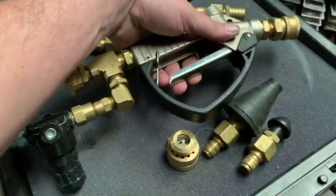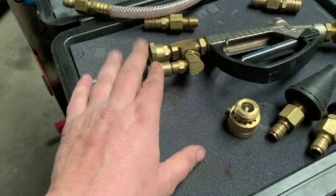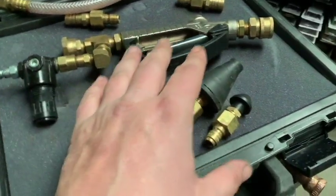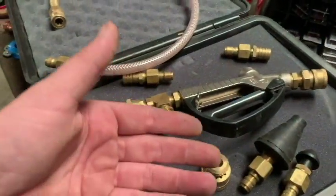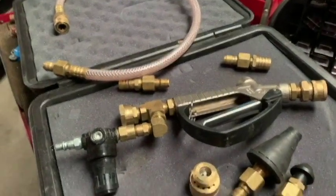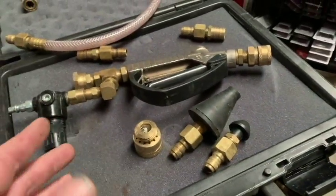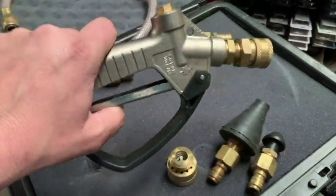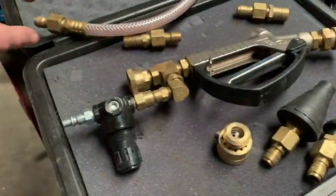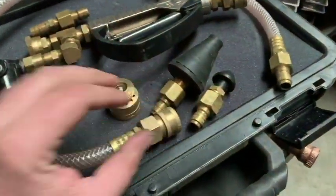The dealership does have a flush kit, and I've seen it in action. It does not offer the same amount of pressurized air that this does. That one is more of a fluid exchanger — coolant flows in one end and gets recovered through the other, without a lot of pressure behind it. It does exchange the fluid, but that's pretty much all it is. This is an actual flush gun. You can pick it up from NAPA — kit number 91002.